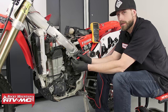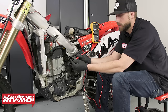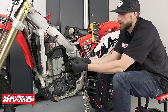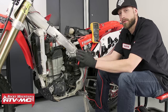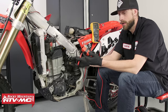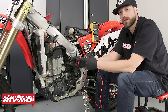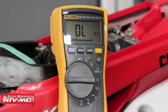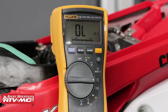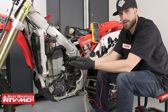The service manual does not give us a number that we can compare our measurement to. However, this is more of a universal test — as long as we're getting a resistance reading, our stator should be in good shape. The service manual for this bike does indicate that we need to take a peak voltage reading from the crank position sensor circuit, but in order to do that you will need a peak voltage adapter. If you don't have one of these, you can get by with just the resistance reading — that will let you know that the circuit is intact. If you perform the resistance test and you read OL on your meter, that will let you know there is a break in the wire and the circuit is incomplete, and you will need to replace the stator.